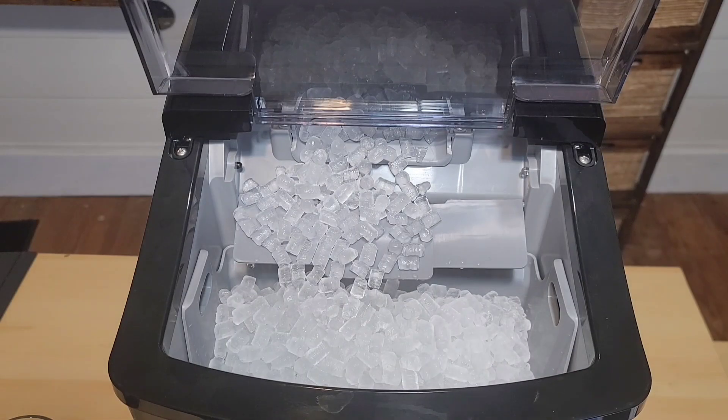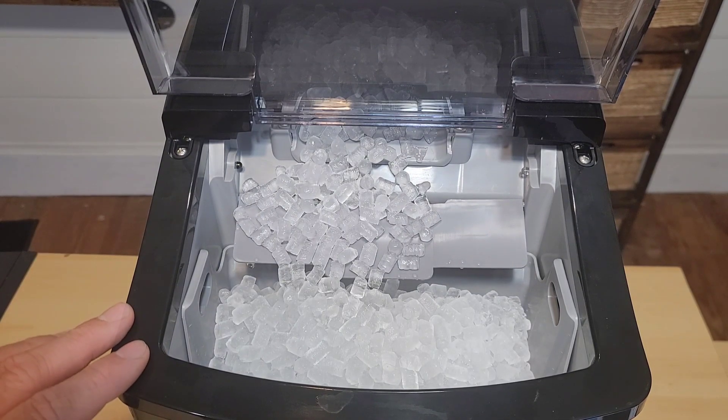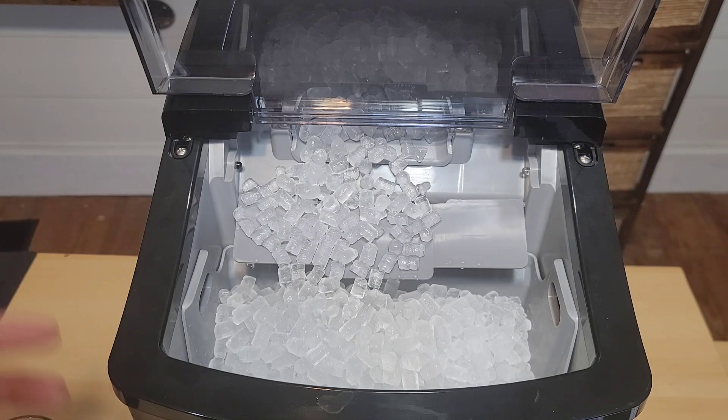There's actually a sensor in this ice maker that will tell it to stop making ice because it perceives the bin as full — and that's what's happened now. The compressor is no longer running. The ice is just sitting in the ice tray. The cool thing is, although the top ice looks frozen, towards the bottom it could be melting — since this has an insulated surround but it's not frozen like a freezer. That ice will drip back into water and go into circulation. They recommend you change the water every 24 hours so you don't keep circulating the same water, and you drain the water through those tubes in the back.